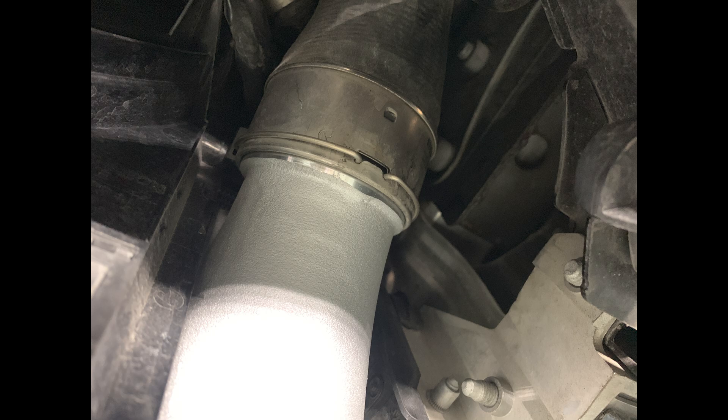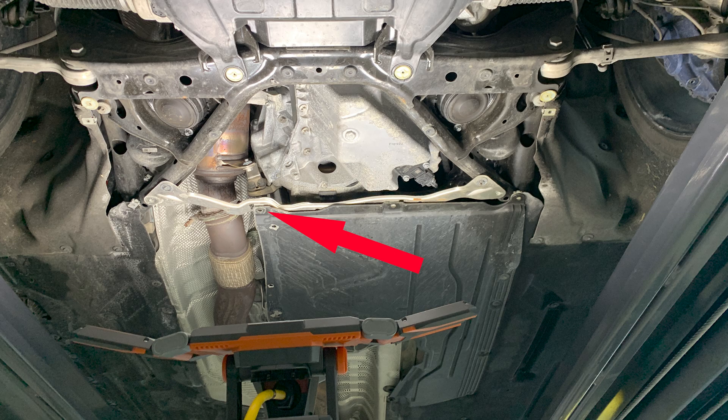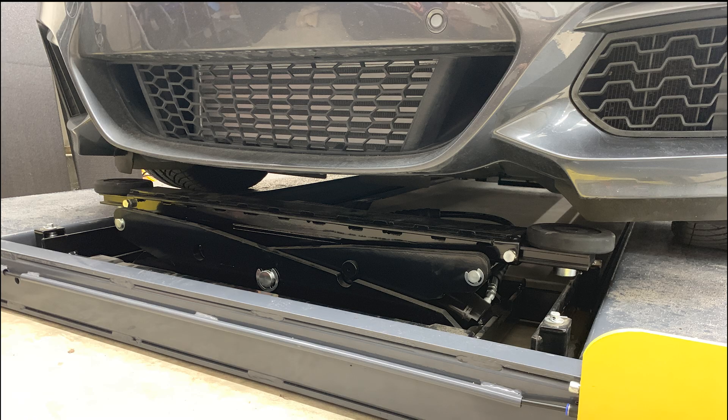Now install the hot side charge pipe. You can now reinstall the two bolts to hold the new intercooler in place. Before putting the skid plates back on, I do recommend starting it up and giving it some revs to make sure you don't hear any obvious boost leaks. I used a cable tie to keep the middle skid plate piece in place and then went for a quick drive around the block to make sure there aren't any boost leaks before you button everything up. That's not a great way of holding the middle skid plate, so I wouldn't go above city street speeds — but definitely worth going for a shakedown run before you put all the skid plates back on. Once you confirm it's not leaking, get the skid plates back on and you're done. Hopefully this was helpful — I will see you in the next one. Good luck.